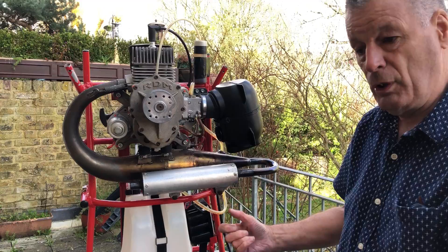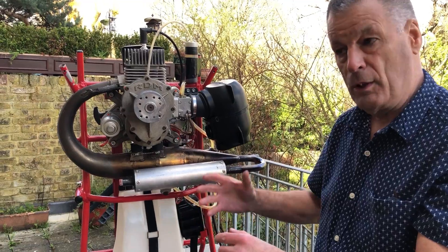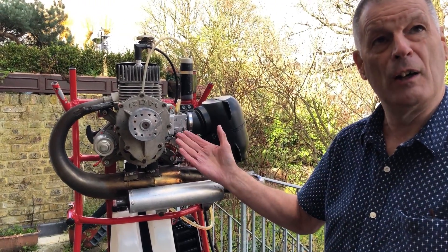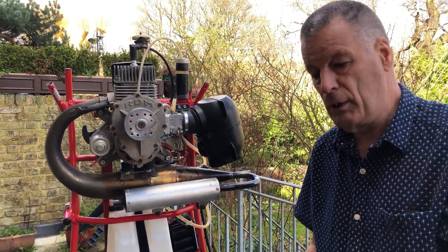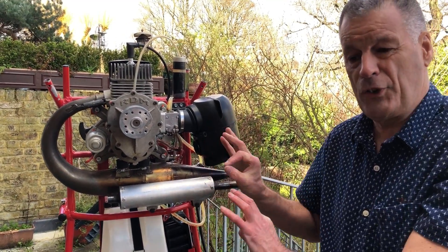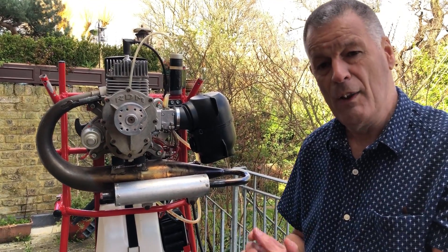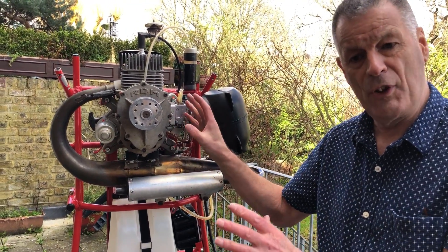In any aviation, you sit there for a few minutes and warm your engine thoroughly before you even consider going out flying. You don't go to full throttle at any time until you're ready to take off. An engine like this should be able to get you well off the ground on half throttle or three quarters throttle. You warm up until you're absolutely sure that everything's nice and sweet, it's running correctly, and the tick-over is lovely and even. I would suggest an absolute minimum of five minutes — possibly just take your time, don't be in a hurry to fly.